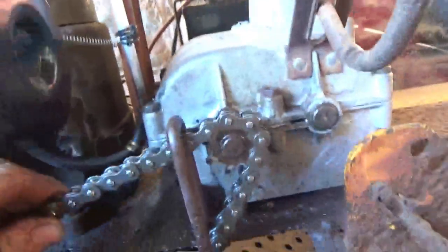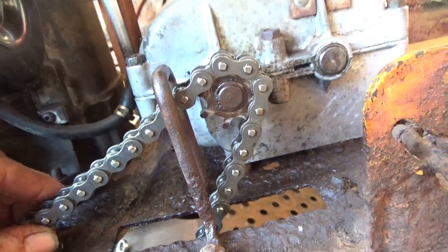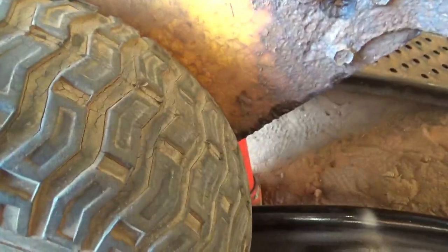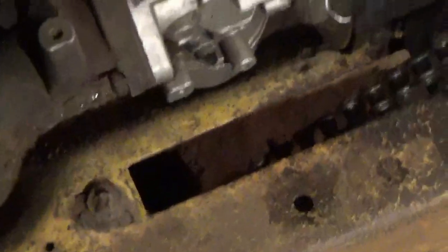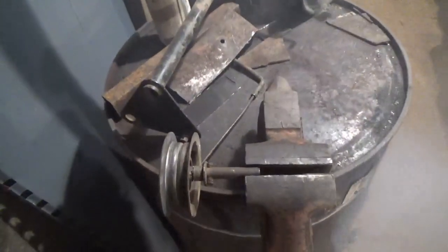The chain finally arrived. Doing a little bit of adjustments because it's not fitting right — it's got a little slack and it's trying to jump up here, but I'm pretty sure I've got that figured out. I've got to get the axle adjusted so it's not rubbing and everything's clearing properly, then we can worry about the belt system. The chain needs a chain tensioner, so I'm actually making one right now out of a flat idler — I'm going to cut it and then weld it to the body.